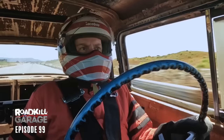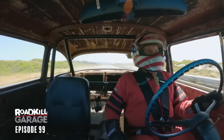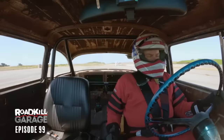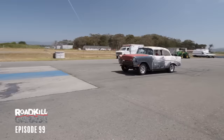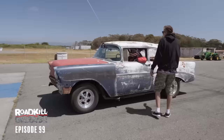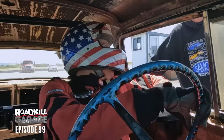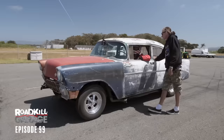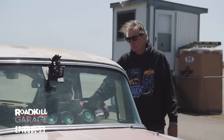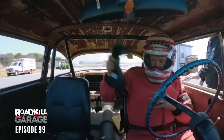11.7. I can tell by the tach that my mile an hour is slowing down — it's making less horsepower. It's hot, the temperature is rising, and the humidity is going to keep it from making as much power as it did when I was running down in the desert. The ignition just cut out — still doing it — and it just died. I think I broke something in the back. You've got a pretty strong headwind you're fighting, it bogged off the line and probably wanted another 500 RPM. I launch at 3,800 — it's all the clutch release. My best of the day: 11.54. That's not bad — 11.38 before, 11.54 today. The ignition is still skipping a beat. We've pretty much eliminated everything with the battery. I'm calling it good, Steve. I beat up the field car like I never have before, and it gave back.